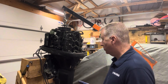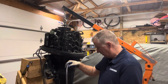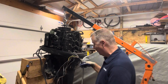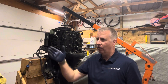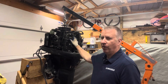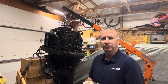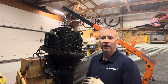We'll start with a compression check. As I look at my wiring, it looks very similar to my OptiMax — this was kind of quickly taken out of the boat. I want to unplug that before I start doing any tests. I might just use a jumper wire, or I have another set of controls we'll plug in to use our key switch. This way we can check spark on all the cylinders while we're doing our compression check. We'll hook up the battery and disconnect that ignition wiring harness so nothing shorts out.